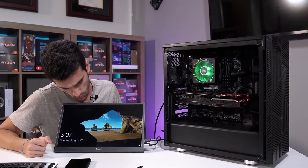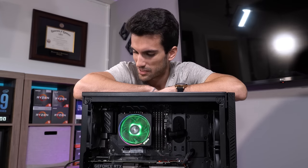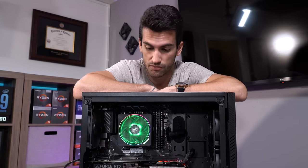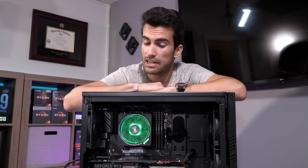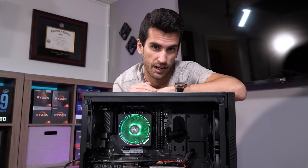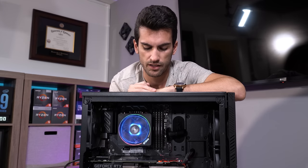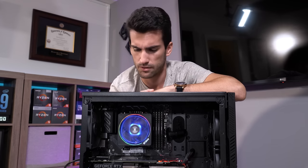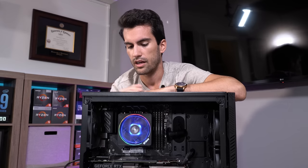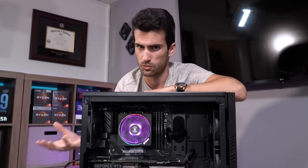Now let's power off and remove the Wi-Fi card. And that's the result we weren't looking for, despite this being the end goal. So let's try a few more things. I've tried pretty much everything I can think of to screw this up, and I can't. The system continues to post — which is a good thing now, at least clearing the CMOS fixed that. But I can't seem to figure out what exactly this viewer did. It may have just come down to the type of Wi-Fi card he had. And if it was a very sketchy one — maybe it was unbranded or something similar — then that could have been the issue, although that's very strange. I've never run into that before.